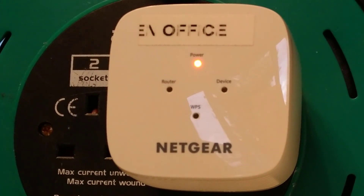It will appear in your wireless list as an unsecured wireless network with the name Netgear. If you connect to that, it should then talk you through the setup wizard to reset up your wireless repeating.